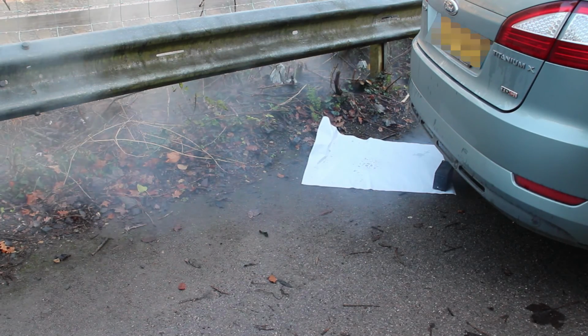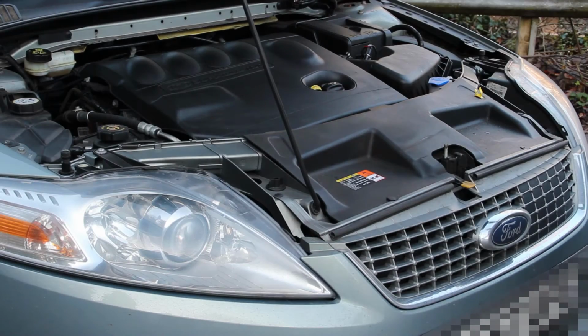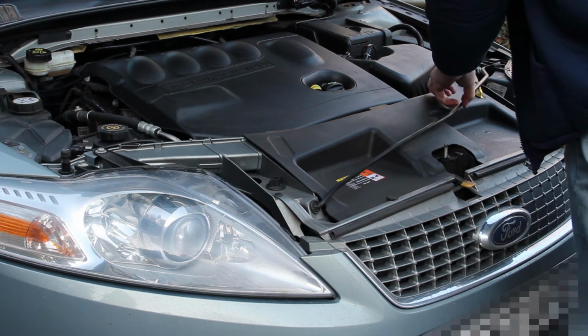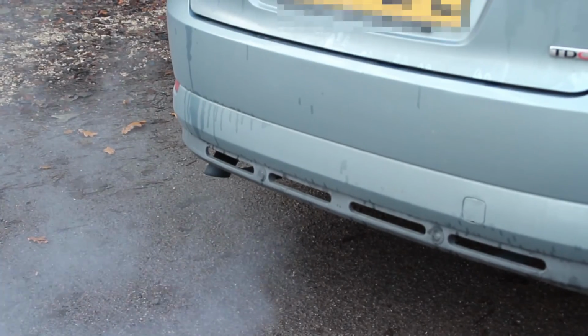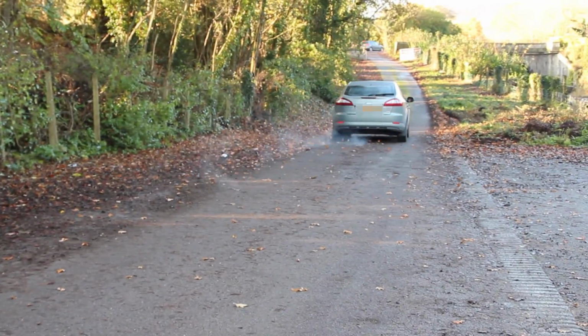As we've been running the vehicle without a valid airflow sensor reading, there will possibly be fault codes you will need to clear. A simple EOBD reader may not be sufficient in all cases. We are now going to take the car for a reasonably brisk 20-minute test drive. The combination of exercising of the turbo vanes and the airflow through the engine will blow the deposits out.